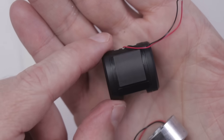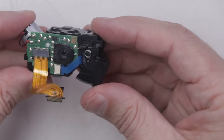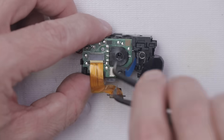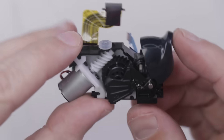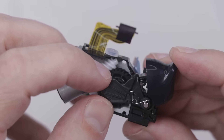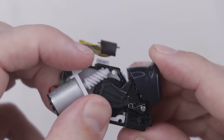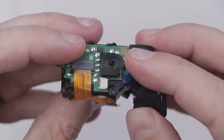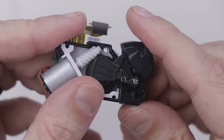And now let's take a look at one of these adaptive triggers. Here is the adaptive trigger system up close. We've got a spiral gear right here, and when that spiral gear turns, it will change the angle of this piece right here. Then you can see it will change how close this is to the trigger, and that will change the resistance on the trigger. Also, you can see the potentiometer on the other side — that's how the controller knows what position this piece is in and how much resistance is being put on the trigger.